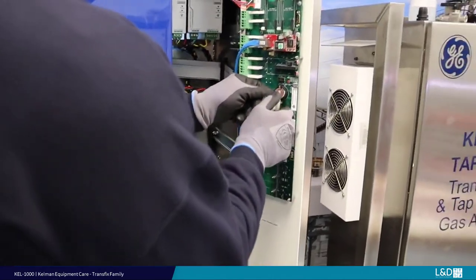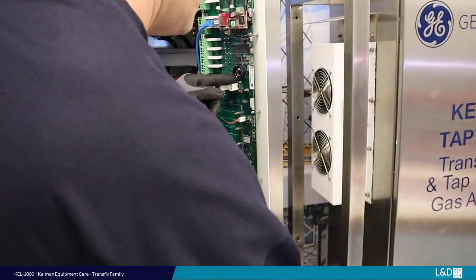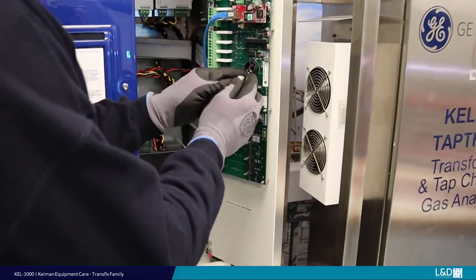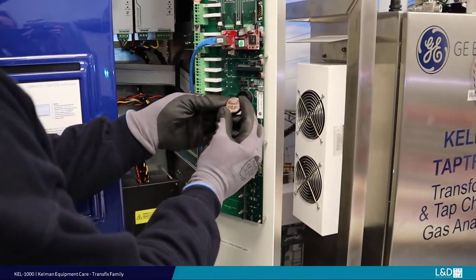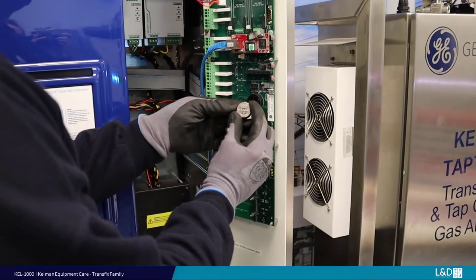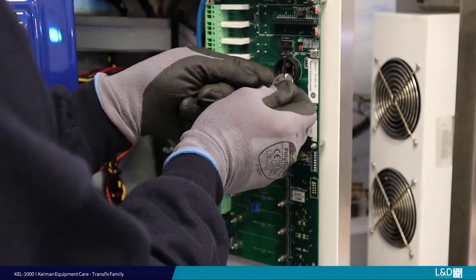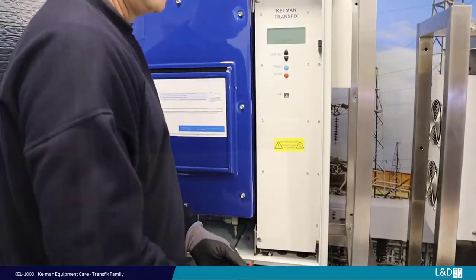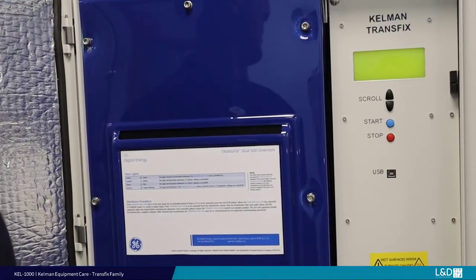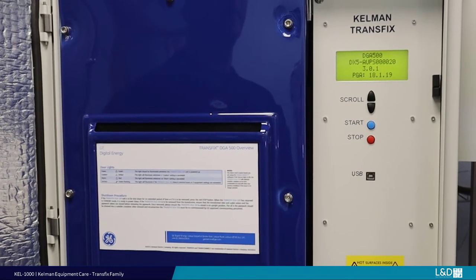Lift and remove the battery with a suitable bladed tool. Replace the battery as specified in the equipment support manual. Here, the date and time has been written on the replacement battery. With the unit powered back on, reconnect with the equipment operating software to re-sync the date and time to your PC.